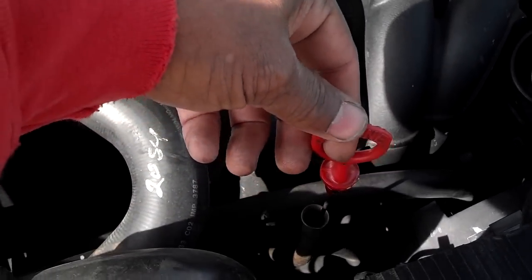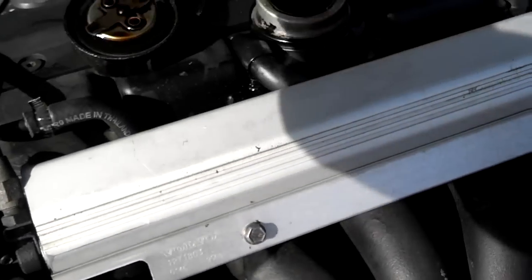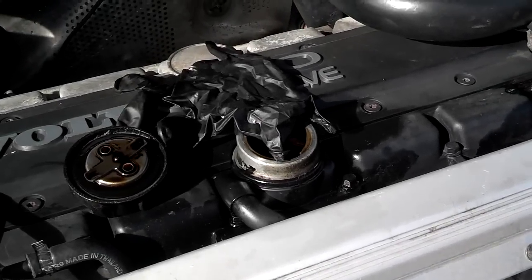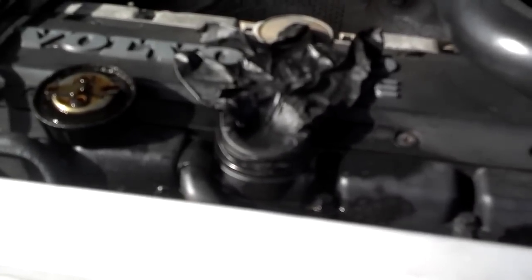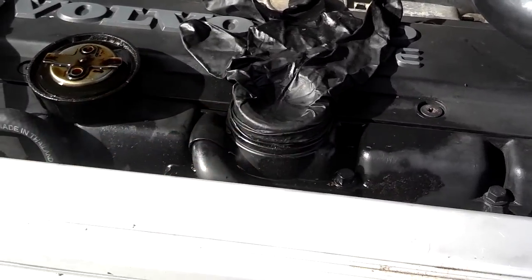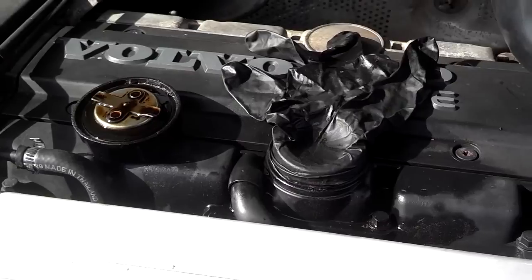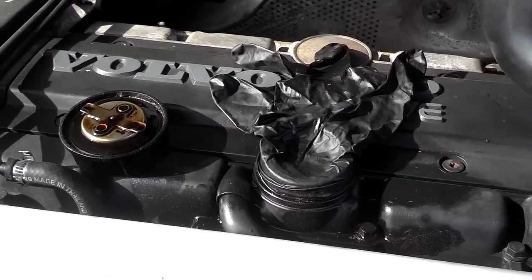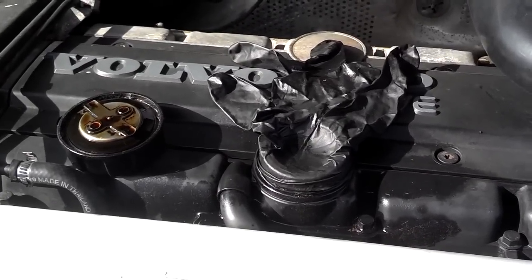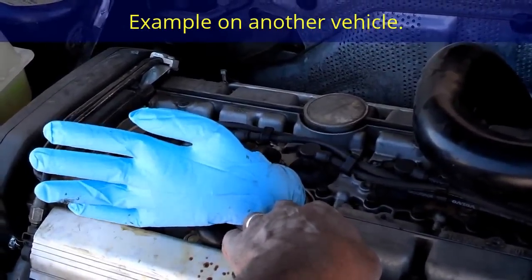However, in severe conditions that doesn't always happen. So what I do is, I remove the oil cap, place a glove over the oil filler, and start the car. If the glove inflates, the system is in need of replacement. The car is warm and running, and as you can see, there's a suction on this glove — and if I accelerate, it'll try to suck in a little better. But if the system was in need of replacement, it would actually inflate that glove and blow it up. As you can see, the glove is inflating, so the system does need to be replaced or serviced.